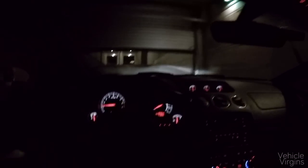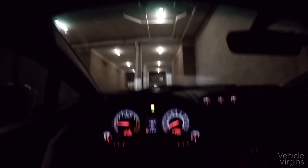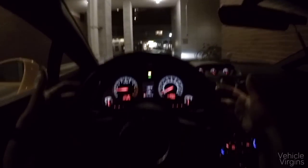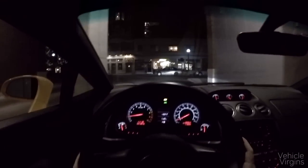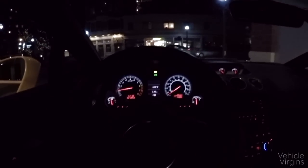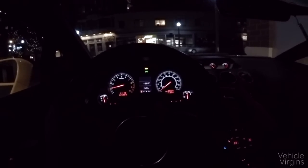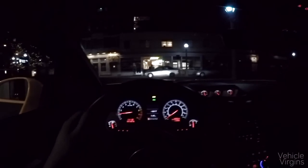As I come up to the edge of the driveway and come to a stop, you pull both paddles to put the car into neutral and hit the brakes. The reason is if you leave it in first gear it puts unnecessary wear on the clutch. Then you pull the right paddle and you're off again — you don't give it very much gas to start. If you give it too much gas, the car jerks pretty violently back and forth. Turning radius: terrible. I've never driven a cruise ship, but it's probably similar to that.